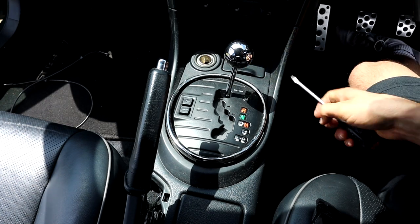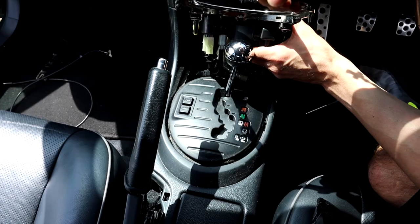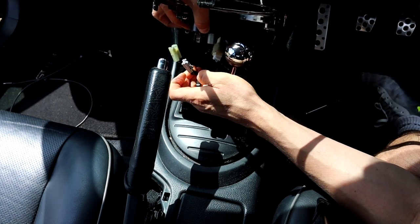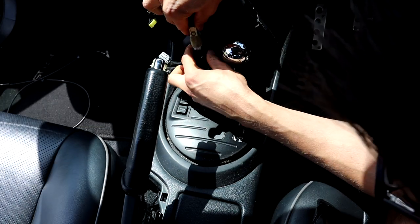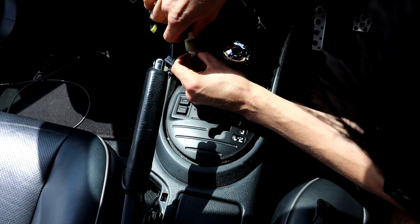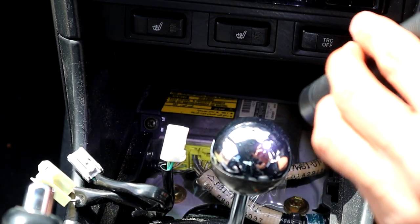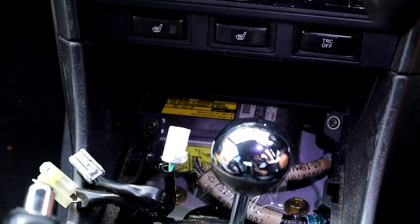Now this should free up the front end a little bit, but there's another part to take out on top. I'm going to use a screwdriver to pry this ring up here, which should bring the rest of this out. Underneath we've got some connectors — there's one for the cigarette lighter. I'll pull those off, and then there's another one with two sides to the clip: a white side and a beige side, both with clips. It's the white one.